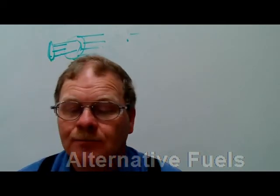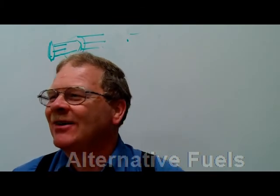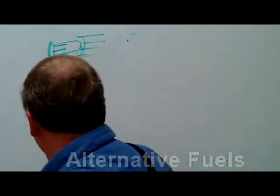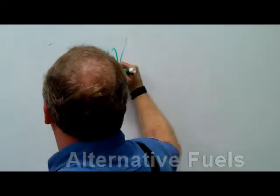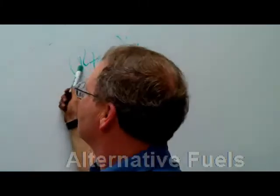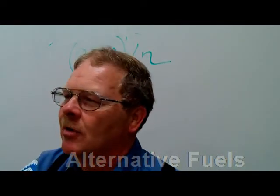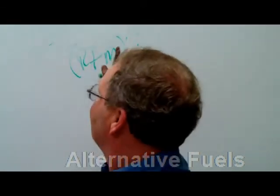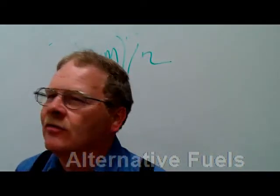You know what it says, the R plus M over 2? You know what that means? You've seen it on the pump. R plus M over 2 method. That's how they check the octane. It'll say R plus M, and then divided by 2. What is it? Research, motor, and you get the average. The research method gives them a number, the motor method gives them a number. These are the two ways that they check it. And then whenever they divide that, they want the average between those two numbers. That's what gives you your octane.